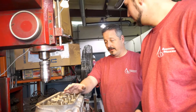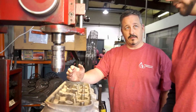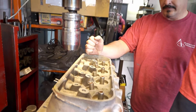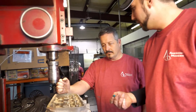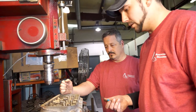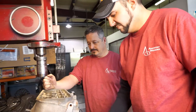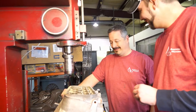The reason we're doing this is an improvement over the factory. The positive valve seal is going to be put on it — more durable, stronger, and will help decrease any oil consumption while the motor's running. So it won't smoke? No, there'll be no smoke. That's important. Exactly — I hate firing an engine up and getting a big cloud of smoke. We don't want that.